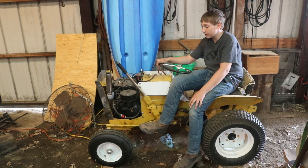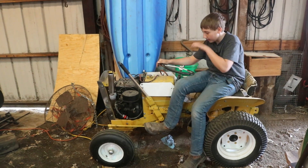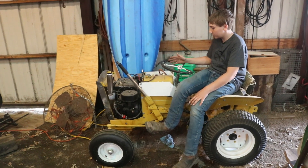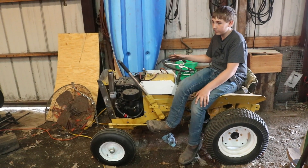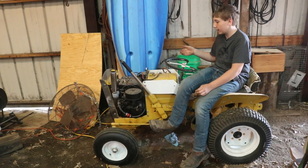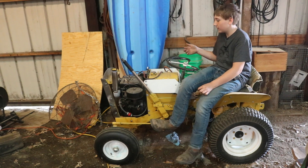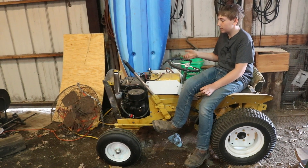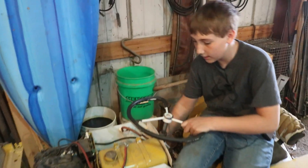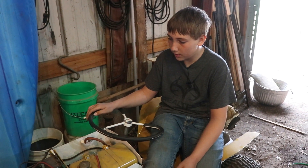This one I bought from Jim too — another one of my early B10s. I got the hood forward inside, but it has an electrical issue. It charges and everything, but it doesn't roll over consistently. Sometimes you'll charge it up and the next time it'll start fine without charging — you just need an electrical current to turn it over. But then you'll shut it off and the next time it won't do anything. The battery's not dead, we tested that. I think we have to grind off some paint on the ground connection because it's not grounding properly.